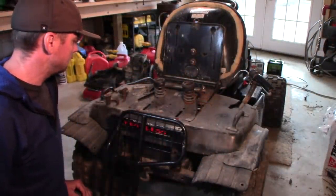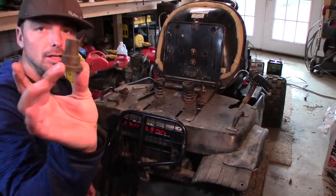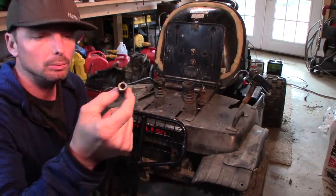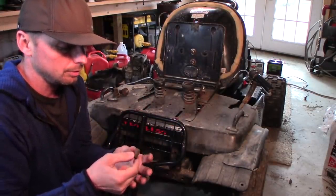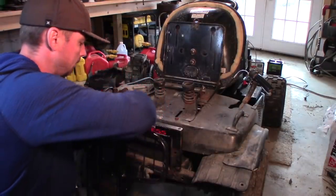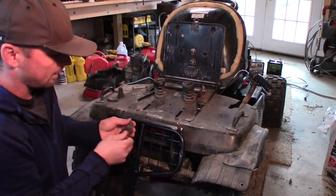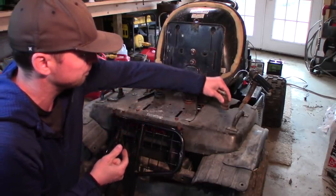Alright, so to bolt this thing down, it's a series of bolts and spacers. As I explained before, these are the spacers for the front. I've got these spacers for the back. They're just basically small pieces of tube steel, like a sleeve for a bolt, just something to keep it bumped up. You could use anything to do this exact thing. Just find a small piece of pipe steel and cut it. But basically, I got 2 back here. These 2 will sit up front with the wide end down. Loosen this one here. Washers on the bottom, obviously, so you don't pull through the sheet metal.